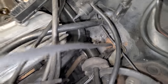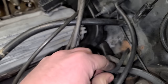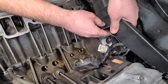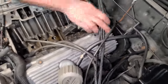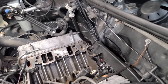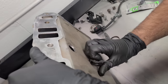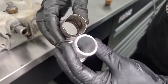We've eliminated a bunch of stuff from the engine compartment, but we do have to add a few things: our boost pressure line, the O2 sensor wideband, and the harness for the AEM. We're also removing the EGR harness since the EGR doesn't exist on this car anymore — the heads are plugged. We only need two plugs at the back plus the knock sensor plug. Our new wires fed through the firewall will be tucked behind the giant factory loom so they'll never be seen. The new PCV grommet goes in — the old crusty one was coming off in pieces.